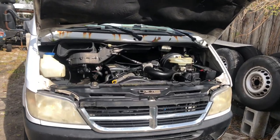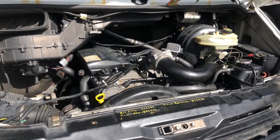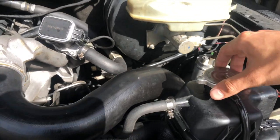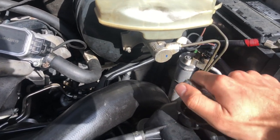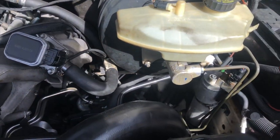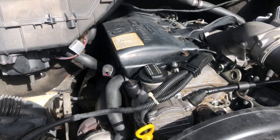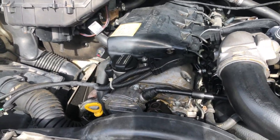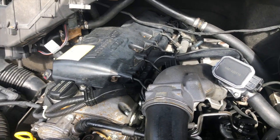It's been a couple days since we did everything with this van. We replaced the oil cooler and have been cleaning out the system — flushing it with Dawn. Dawn and water is a great combination; when you run the engine it gets naturally hot and soapy, which helps clean out the oily residue that built up from the oil cooler being non-functioning. If you look down in there you don't see a huge amount of sludge like before. The previous owner said he took it off the road right when he noticed the problem, so we probably caught it just in time.